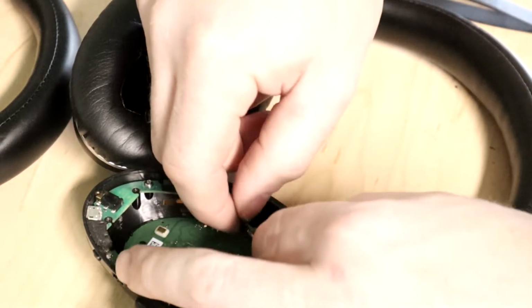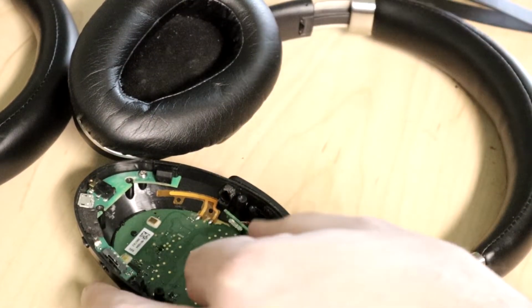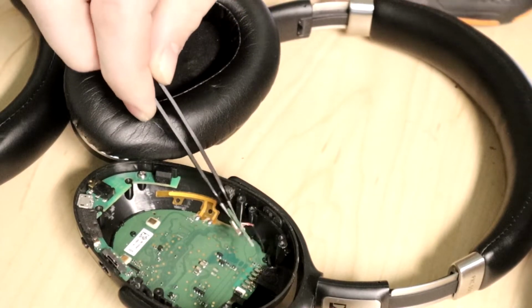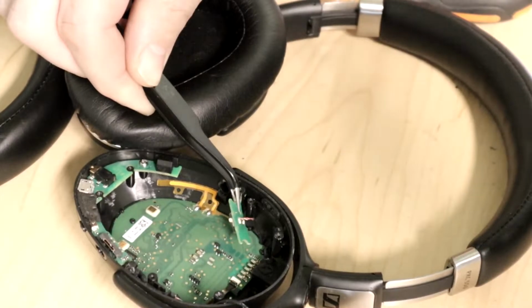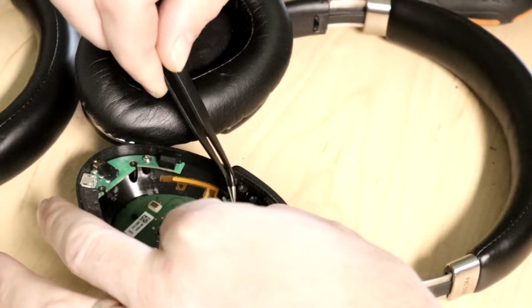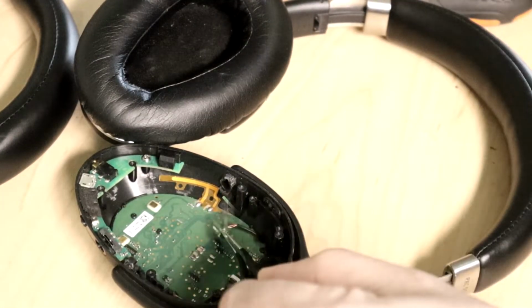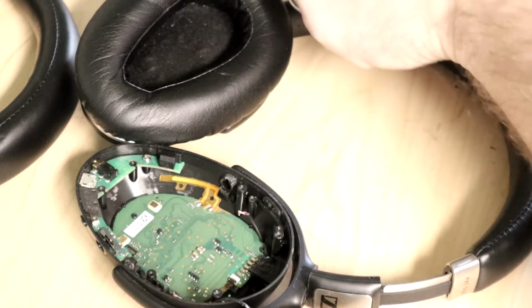Okay, so there's wires coming into it already, which are the Bluetooth wires, as you can see here. So what I need to do is connect the Bluetooth wires together themselves, tuck them back in, so Bluetooth is just always on. And then solder new wires to this switch and bring them to those 2 points that I showed you a minute ago. There we go. There's my switchboard.